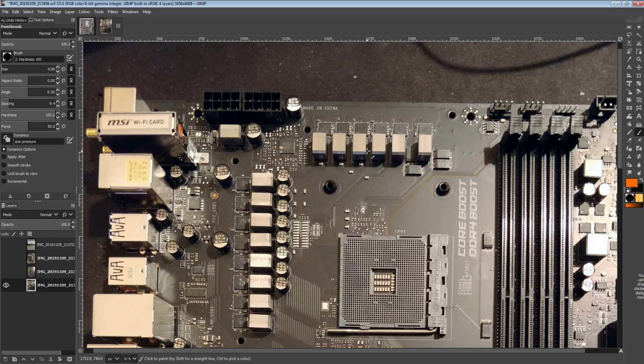So any quantity of 8-pins higher than 2, in my opinion, is very silly, because most PSUs do not come with that. Even if the PSU is fully capable of providing it, if you buy a 1500 watt power supply, it could provide 1500 watts. So if you're going to go past 2 8-pins, you should start using PCIe 6-pins. And you don't need to use a PCIe 8-pin, because a PCIe 8-pin just adds 2 ground wires. It doesn't actually add any 12-volt wires, so it doesn't do anything.